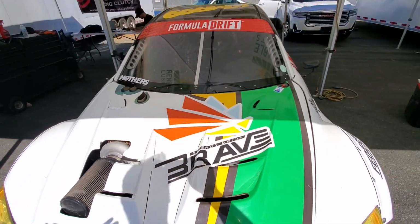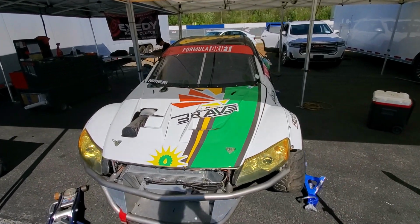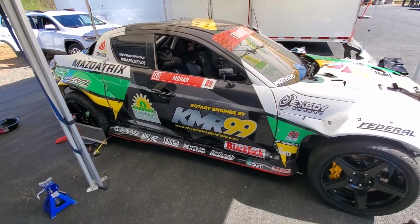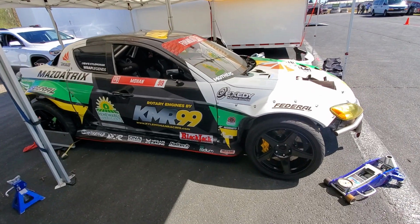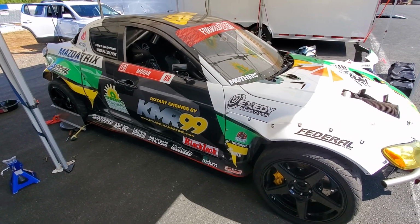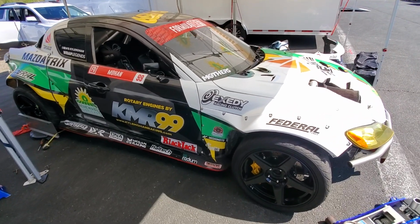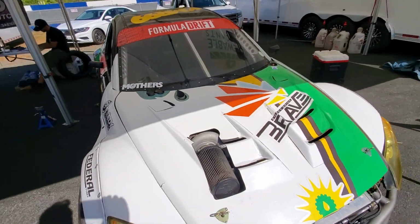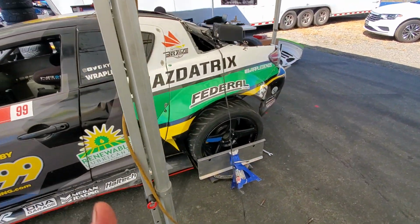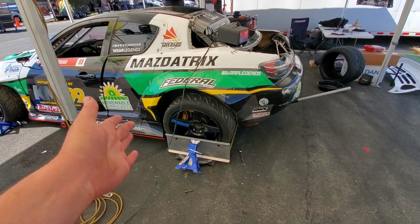So what we're gonna do in this video is break down some basics of what I look for and like to run at any track, but maybe not the exact specifics per an individual track. Obviously with Formula Drift cars, they have a fair amount of suspension travel. Now, if you're familiar with D1 drifting or other styles of drifting, the cars may sit a little lower, which means you have less suspension travel. This is important because when you're setting up your rear alignment, how the suspension moves as the car squats down under the load of acceleration will change suspension geometry.